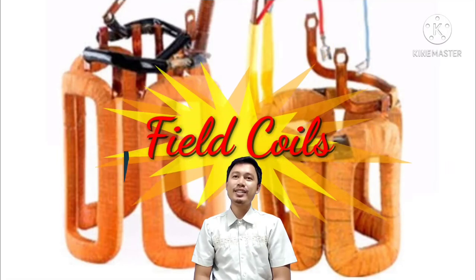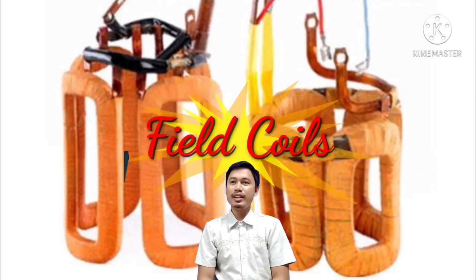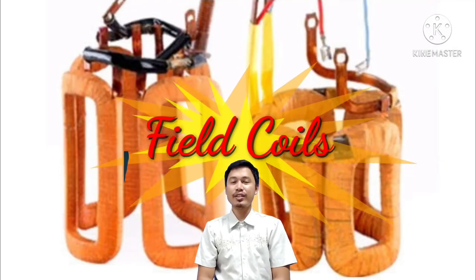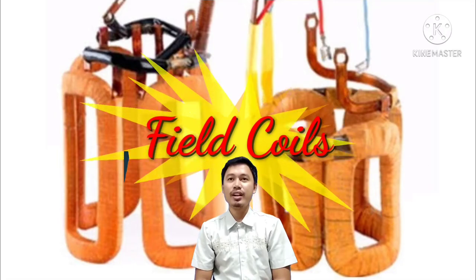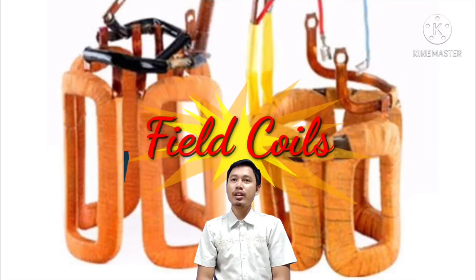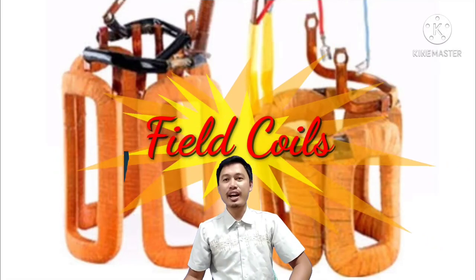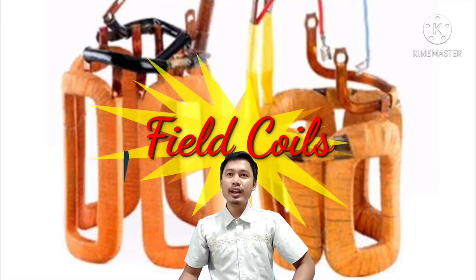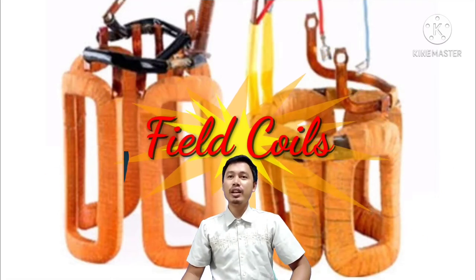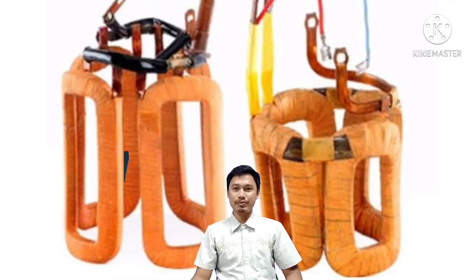The housing holds the starter fields in the housing with screws. This can consist of two to four field coils connected in series, energized by the battery. This converts the coils into an electromagnet, which then turns the armature. When the armature coils are powered, a magnetic field is created around the armature.